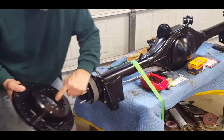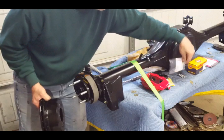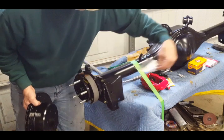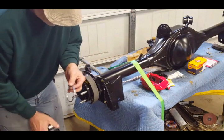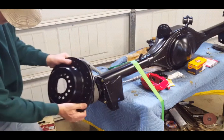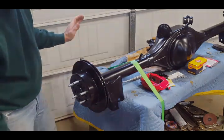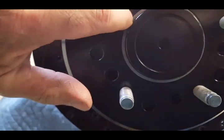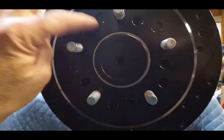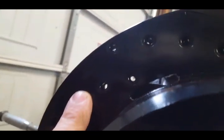In this case, the hub here is bigger, so I need to use an adapter called the rotor registration ring. It comes in the kit — part number 300-11337. The cone shape faces the rotor. You line up the studs properly and slide it on. This is an aluminum ring that is tapered so it works on the hub. The slots on it are for different vehicles.